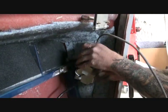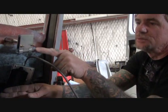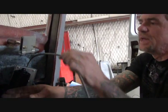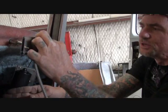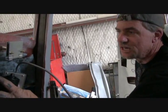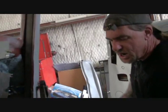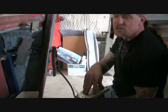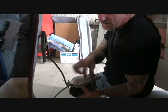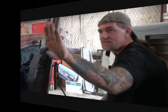So once you install your motor, just like you see here, and it comes with all the hardware, you will have to make a tube, just like you did for your gas lines and your brake lines, a tube that comes here and goes around over there. Make sure that it's in a big enough loop where it doesn't bind up. So let me get the tools, and I'm going to show you how to make those, and we'll get the motor mounted on there. And then the tricky part is when I take this off, I'll show you. There's a little arm in here with a wheel, and that has to be set. So both these arms stop at the same time and they go the same.